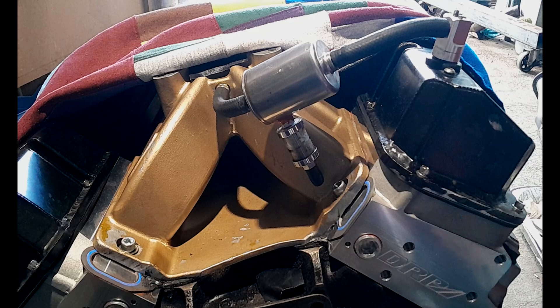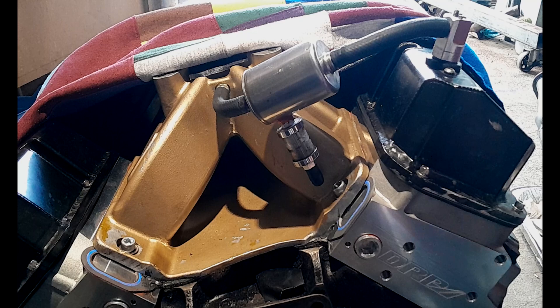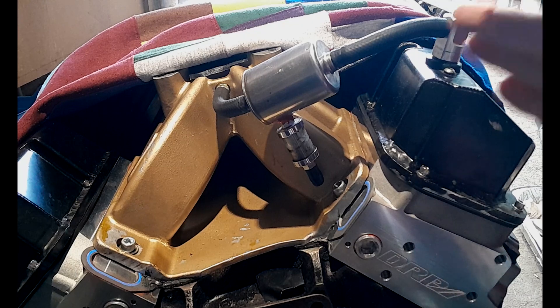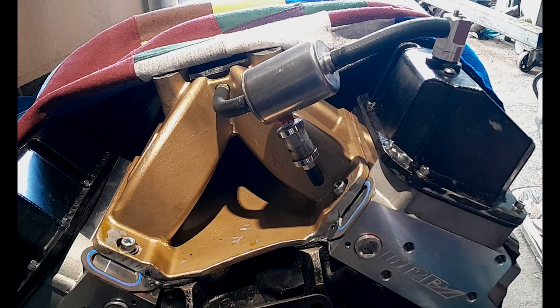The problem was when I first started doing it, it was with a stock PCV valve and no filtering between the PCV valve and the top of the manifold — which is where we plug in to get vacuum to draw gases out of the crankcase. Without a catch can, you're basically recycling burnt oil, burnt fuel, gases, condensation, etc., back into your intake manifold, back through your runners, and burning it through your engine again. A lot of factory setups do that, but we can add a catch can in between to capture that contamination.